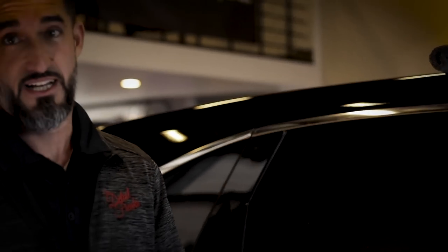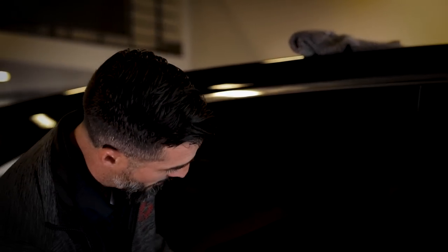I want to hydroplane, all right? I want to be on top and just have the polish interacting with the surface and not the pad. That's the key, all right? So that's why when we finish down a lot, it's always with soft black, GM black, whatever black you want to say is the softest, we'll finish it down with a stiff pad every single time, every time. You ready? I'm ready. All right.